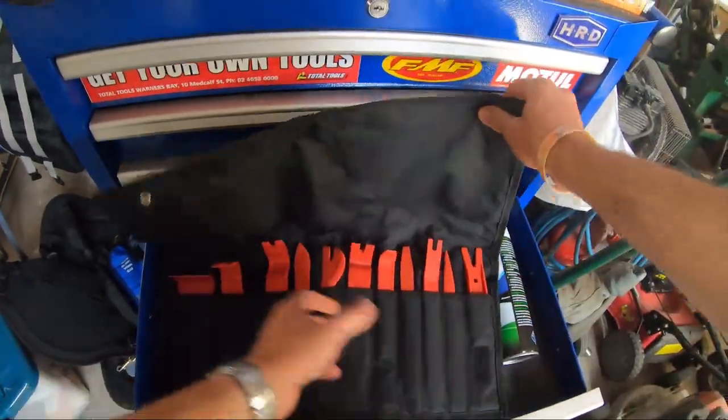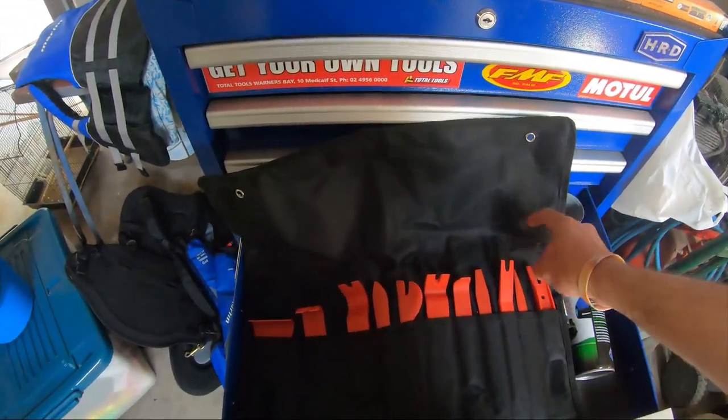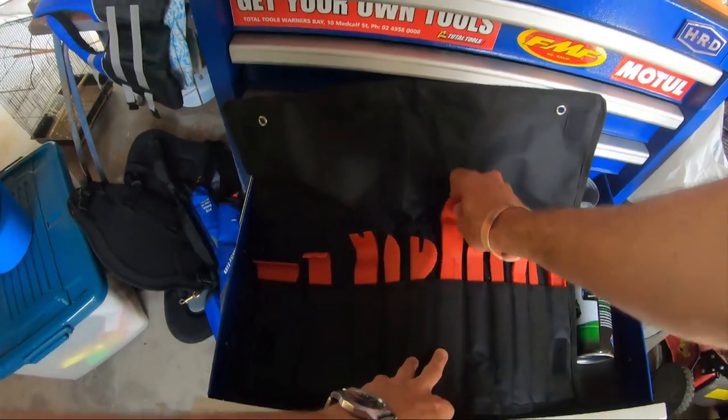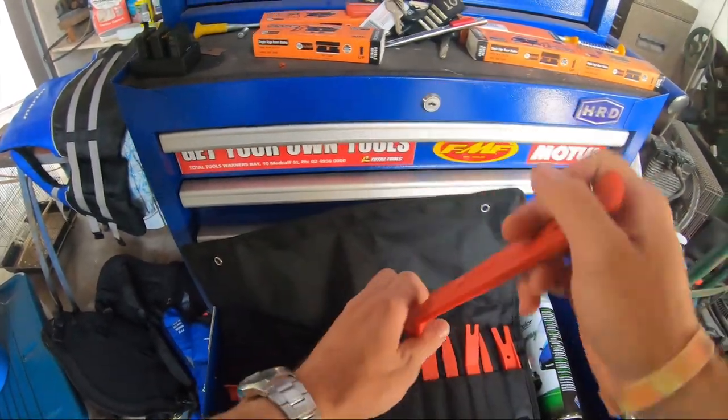You can go out and buy yourself a plastic trim tool set like this — you can usually get these online for about 20 to 30 bucks. They don't need to be anything too fancy, just a nice little pry bar, something simple. Get under the plastic and pop it up just underneath this edge here — just give it a nice little pop and they come right up.